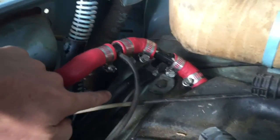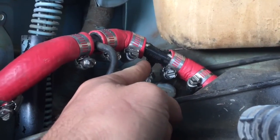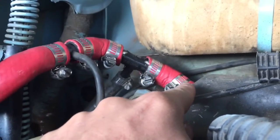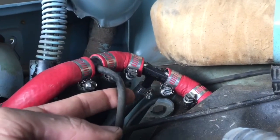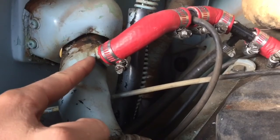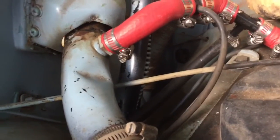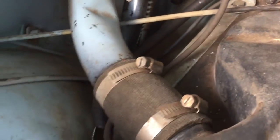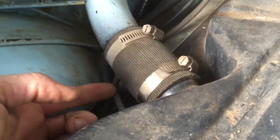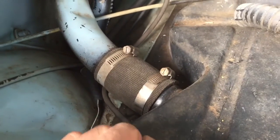Underneath the fuel tank, it lines up to a tee that goes into the top portion of the tank. That area also has a breather line which tees into the fuel filler. This is not a vacuum line — it's actually a breather line connecting right here. That's the stock arrangement, and that's the fuel system.